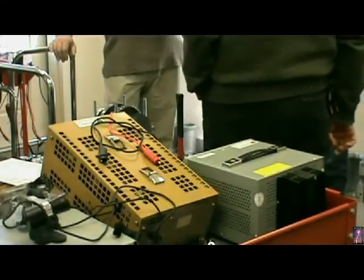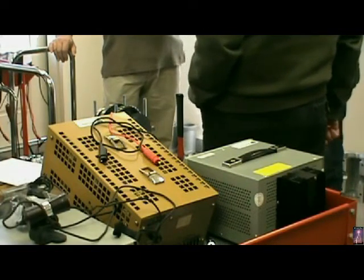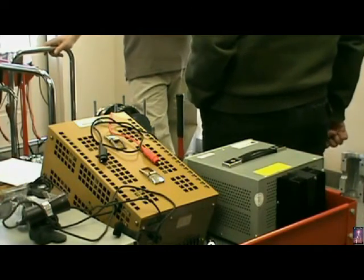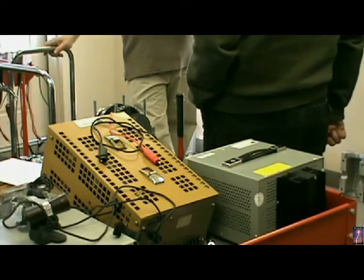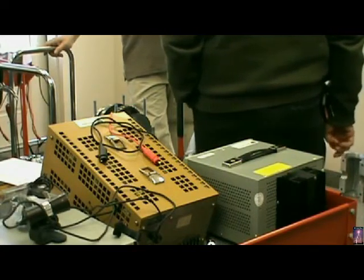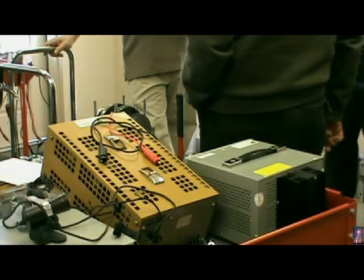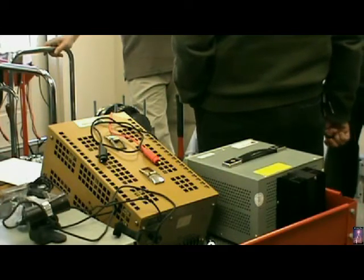Question: do you want him to take one head down and use the mill to take that high spot out on all 4 of them and try that? I'll show you what I mean. I really think we should take them all in and take that one ledge down. Right now it's got to be a quarter of an inch across; maybe take it down to 1/16. Well, you wanted to do the one and try it, and if that doesn't do it, we can go further, because this is easy to do. No, I don't want it done that way. I want it taken down so there's a 1/16 of an inch ledge left at the bottom, so the plug can see the gas metal part.